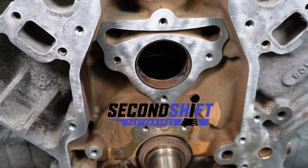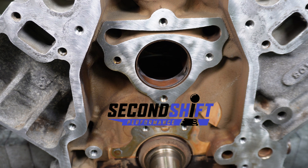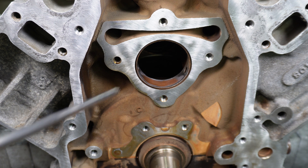Before we get started on these camshaft bearings, I just want to take a minute and show you guys the amount of wear on the camshaft bearing. While this looks extreme, this is very common to any LS, LQ, or Vortec engine that has 100,000 miles or more on it. And this happens to some engines well before 100 — you can have this happen to your cam bearings by 50,000 or 60,000 miles if you've got strong enough valve springs on there.